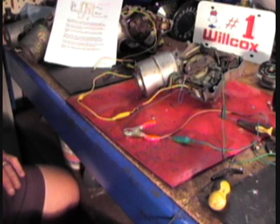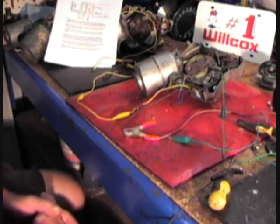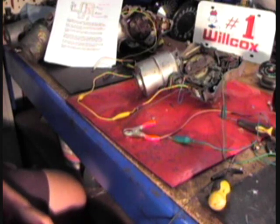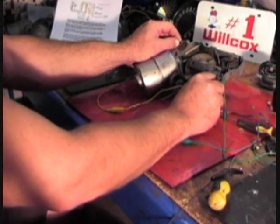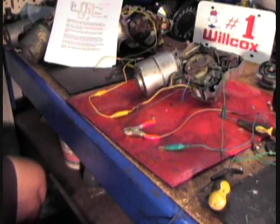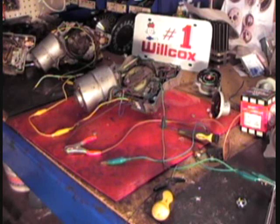If you've got just a clicking noise, I would run an independent ground. You could also do the test in the car — remove the wiper switch, pull the connector off the back, and run some grounds manually. Ground out the yellow and blue and see if you get low speed. Then drop the blue and see if you get high speed. Then pull the yellow off and see if it parks. If the motor functions properly there, that'll point you in the right direction. For suggestions or questions, email me at WilcoxCustomerService at WilcoxCorvette.com.